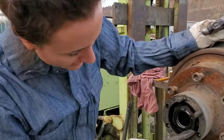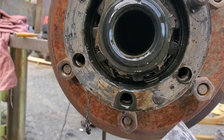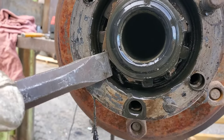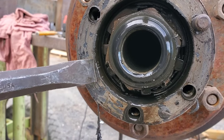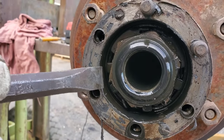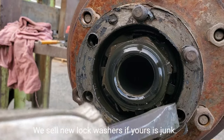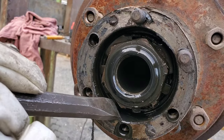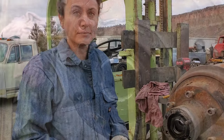Inside here, when we get the axle shaft out, you'll see that there are these tabs that hold the nut. I actually just broke that one off a little bit when I tried to peel it back, and that's okay. Your nut's not junk after that. When you go to reassemble it, you can just fold one of these other tabs over — there are extra tabs there.